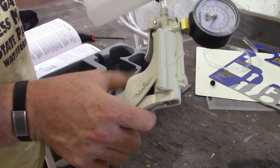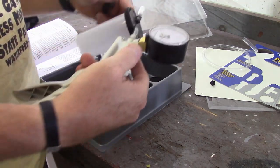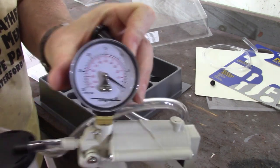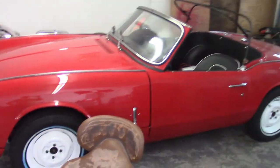You can hear it. There's also a release down here. This little knob down here is what will allow you to vent it off without pulling it off. A little conveniently put there. And then obviously you can see the gauge here goes from atmospheric down to about 30 inches of mercury. It says it will draw for 25 inches. Get the car up, get it on jack stands, get those rear wheels off, get the master cylinder topped off